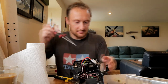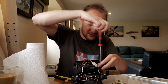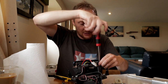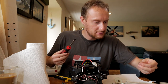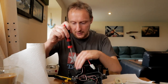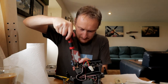And I'll just take the body shell mounts off because these are some of the worst screws on the whole car, so they will definitely need treated with Q-Rust. I don't want to treat Q-Rust in situ because it damages plastic. I think it softens it, so let's make sure it's completely clear of the vehicle. Oh wow. Come on. There we go.